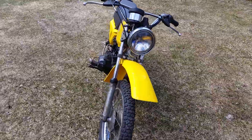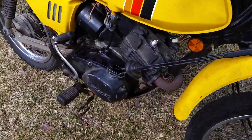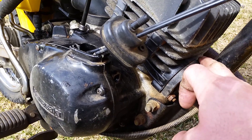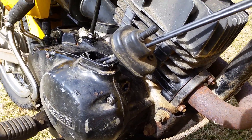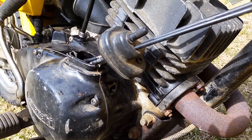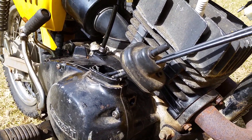This is the shorter version of the KE100 but with the KD style. The motors are basically the same, but on the KE100 the exhaust port is in the middle because it has two poles. This is a KD style, but the motors are pretty much interchangeable — you can put this on a KE100, you just have to change the cylinder over. Same stroke, same bore, pistons are interchangeable.